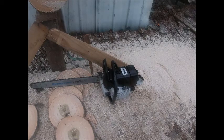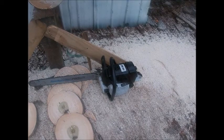If you watch the 200T video, if you'll remember, the rings seated on camera because it went really rich. Well, after a few cuts with this, it got really, really rich at idle. And that is a deal with the long intake duration. You're going to use a lot of fuel. Real finicky to tune, but this one ain't too bad. Maybe in the summer when it's warmer it might be a little different, but where it's cold out, it's going to want to be fattened up.